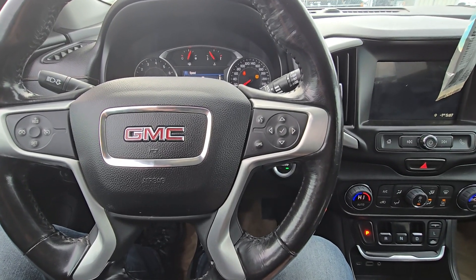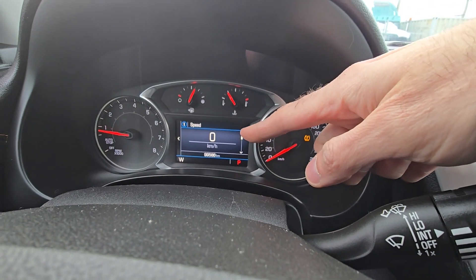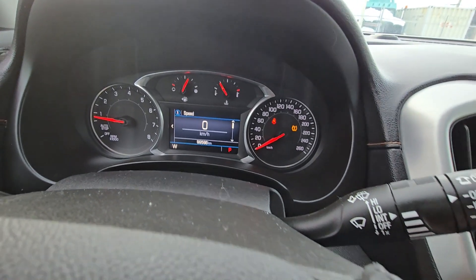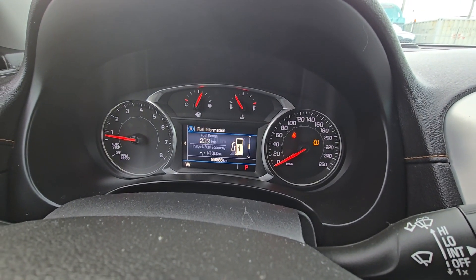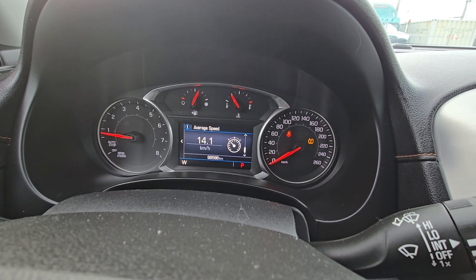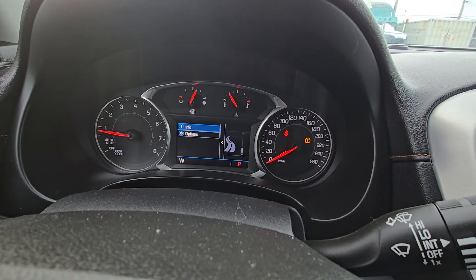You can check the battery voltage right here through the menu on the instrument cluster — you just have to enable it. If you scroll through that menu using the buttons on the right side of the steering wheel, the battery voltage should appear under the selection. But if you don't have it there, you have to press the left button once to get out of the main menu.